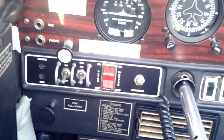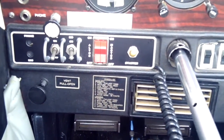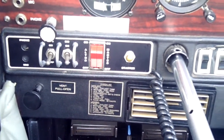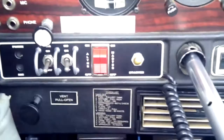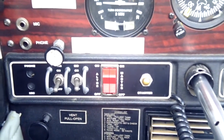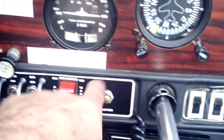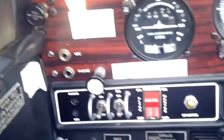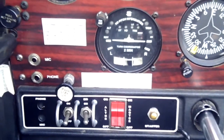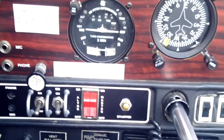Good afternoon, ladies and gentlemen. Here we are back with the electronic ignition install, and we're actually finished. The manifold pressure sensor box is plumbed into the manifold line, the controller is hooked up, and we installed two breakers in the panel for it along with a new switch plate and a new left-hand panel. We also put in a new master switch — the old one was kind of sticky. This completes the electronic ignition install. We've already done an engine run-up. These new left panels are out of metal, so they won't roll and curl like the vinyl. This is number 11 for Yankee Aviation. We hope you found all this information informative and useful. Thanks for watching and have a good day flying your Grumman.